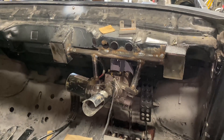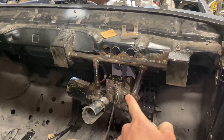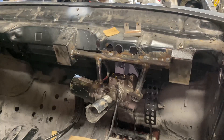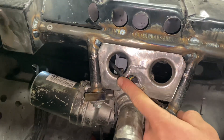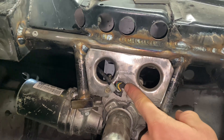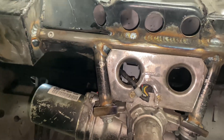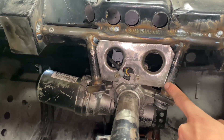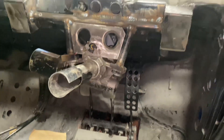Okay, that's the column support tubes now fully welded in. There are one or two bits just in behind that I'll get to once I've taken the actual steering column off. The last little piece of the puzzle I've just been fabricating up is the gusset plate I mentioned before — I've made one up. It bolts up like so from these two points here, it's notched so that the wiring can poke through, and I've run it through the swaged hole because I'm going to relocate the ECU somewhere down here, so both plugs are pointing down that way. I'm just going to clean these tubes up and stitch it along, which should make the column support nice and strong.